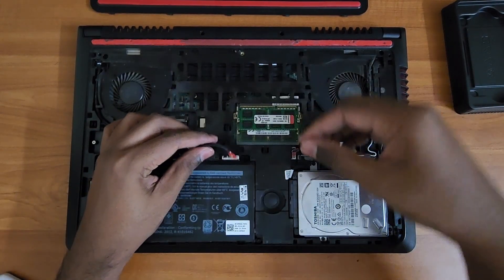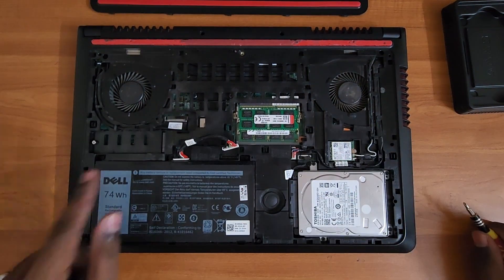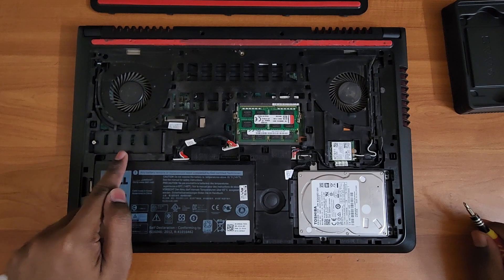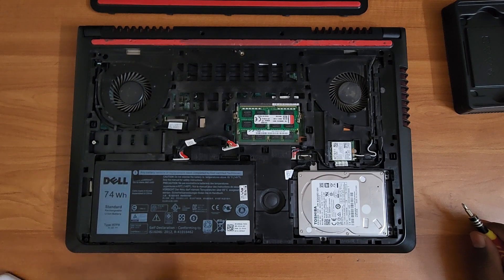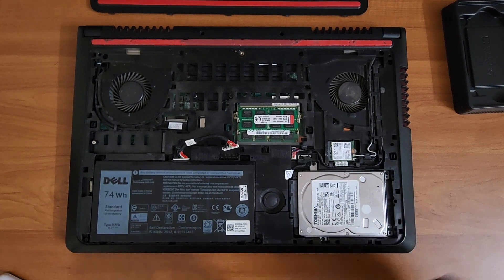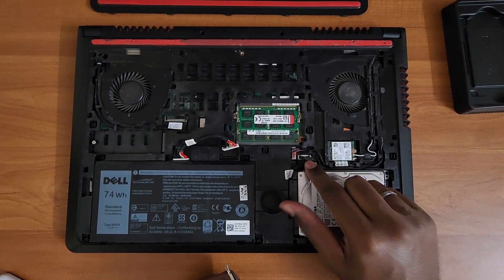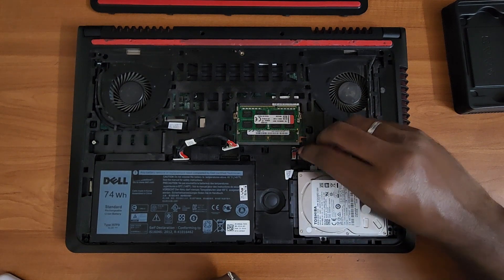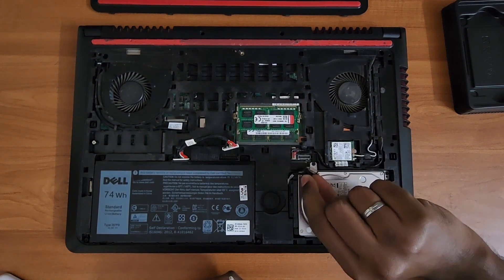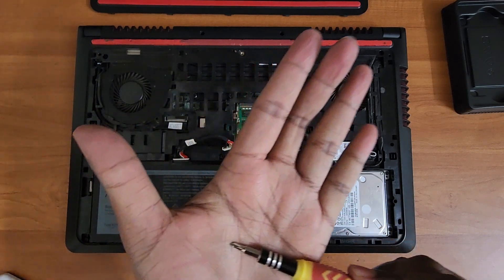Now after you remove the battery and keep it aside, you can start the next step. We are not going to touch the M.2 SATA yet — we're going to start with the 2.5" hard disk. There are four screws, but before we go there we need to remove the existing hard disk cable. Very important: don't damage it, we need it afterwards.